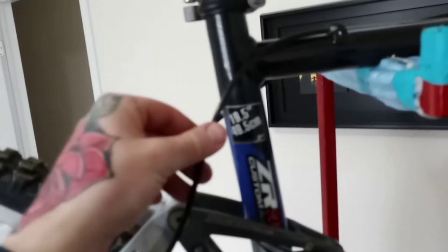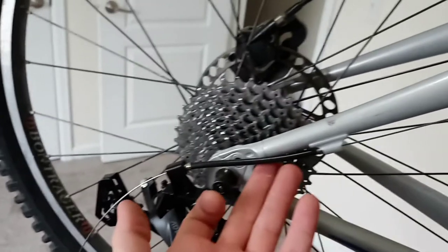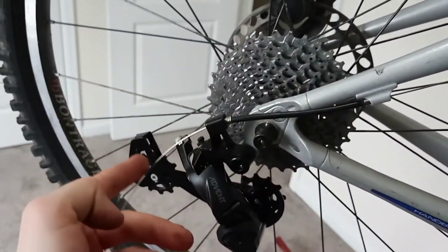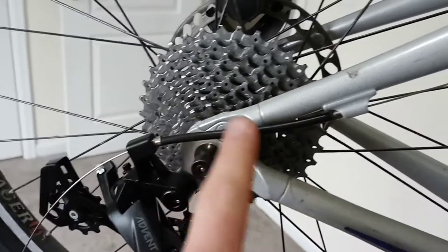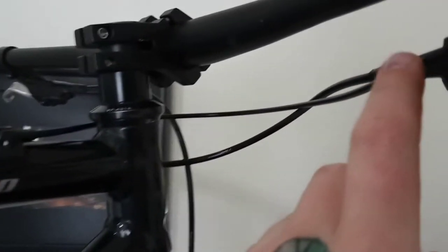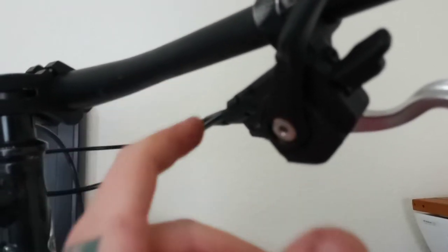After some fighting, I reused the original housings. The first one fit perfect. The second one I had to modify because the old housing went longer, but with this new Advent derailleur the mount is quite a bit shorter — almost half. So I modified that housing and it works good now. I also bought a brand new Bontrager shift cable housing and cable kit, and modified the housing to work with the new MicroShift thumb shifter. It came with the shifter cable, so I just had to use the housing. Now I got it all run right — looks like it should work good.